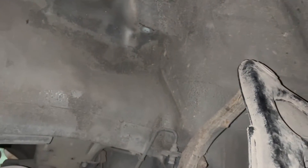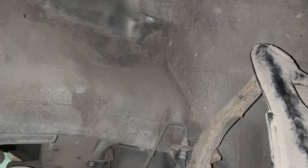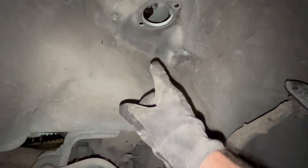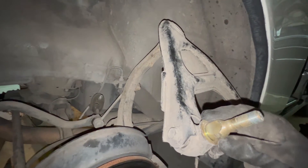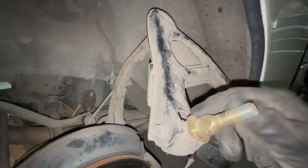You can see this control arm here has been taken out of the way — it was bolted into the top. The strut went right here and the control arms went around it. This one's a bear to get out because it's pressed in — one came out easily but the other you have to beat out with a dead blow to break it loose. Now it's all empty here and we're about to put the new coilover in.